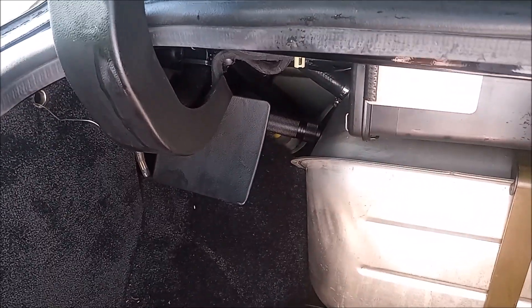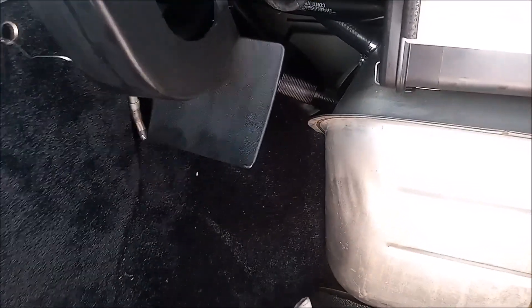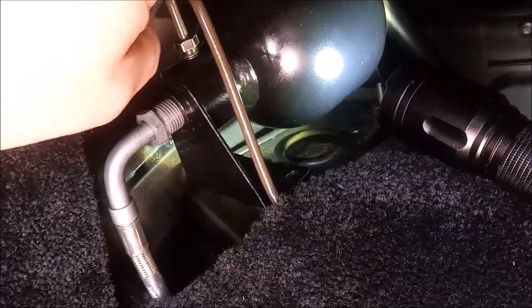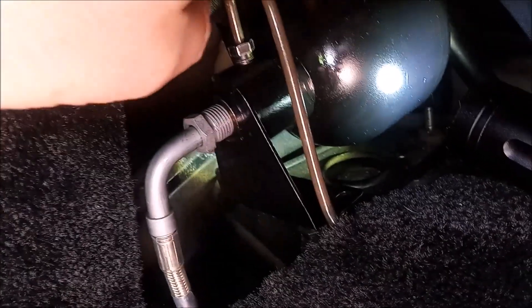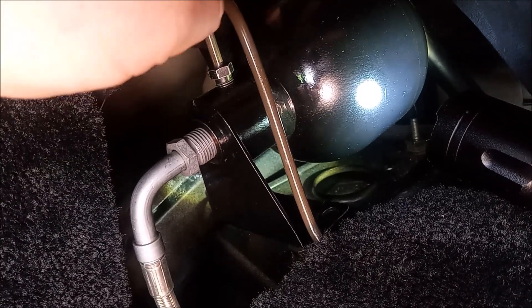I'm on the left side of the car now putting this one in. One suggestion I need to tell you about: I've been working here for the last 15-20 minutes trying to get this together, and I realize you need to know that when you put this in, don't seat it down into the studs right away. Get this one fitting connected first, then get the other one connected, and then seat it down into the studs — or at least get it threaded a little bit. Because I made the mistake of putting the three bolts in place on the studs first and nothing lined up. I had to pull it back off the studs and then twist a little bit to get these threaded. So do that first and then bolt it down with the three studs on the base.